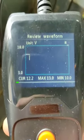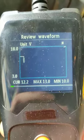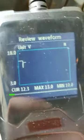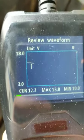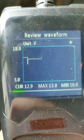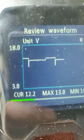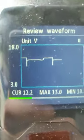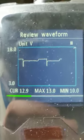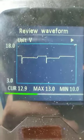So let's just go. Notice that I've engaged the lift pump, the hydraulic pump, and then it's 12.2. It has read 10 minimum, but we can't get it spot on. So there we go, she's loaded up: 12.3, 12.9, 12.2, and I've dumped it again. Every time you see a dip, a spike going down, that's when I'm engaging the lift pump. So it's holding 12.3. Now 12.9 when I release.